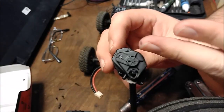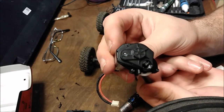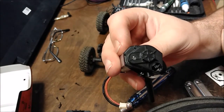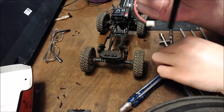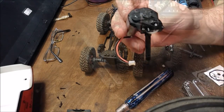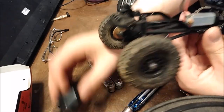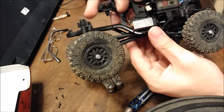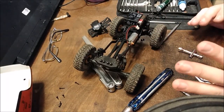I did have to drill a little hole to clear the motor shaft, but I got it. My spur is a little warped — that's why it sounds like that. If I don't like it I'll put the stock pinion on, but I think I'll have to glue it because it's kind of a loose fit. So we've got the motor installed — that's how it would be normally. Now if you're going to keep yours stock, you would have to cut this foot off in order to put this motor in here. But I'm not keeping mine stock, so I'm going to do a couple of changes.